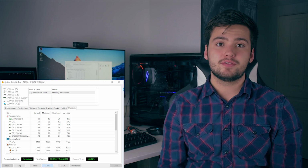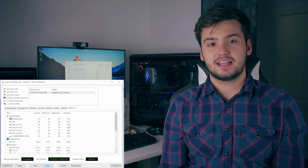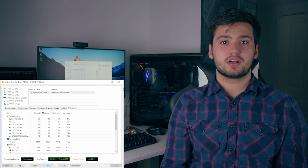All right, guys, and the thermal testing for the Arctic Silver 5 is done. Are we like 10 degrees lower? No. We're actually at 57.4, which I would say is a temp drop, except for the fact that ambient in here is about 1 degree, 1.5 degrees lower than what they were when I was doing the testing for the other two. So yes, it is a couple degrees lower, but it's not the mythical like 10 degrees lower.